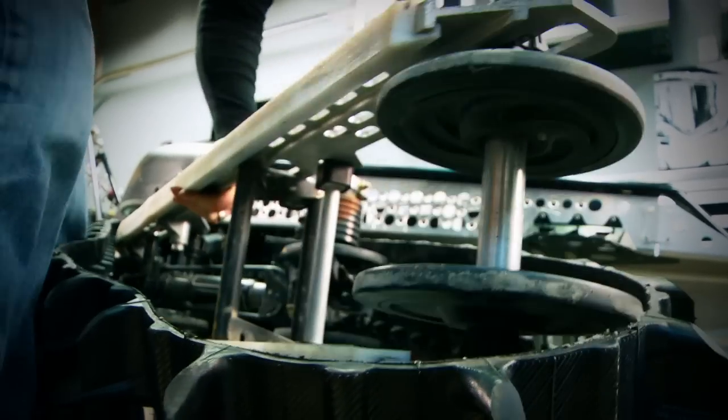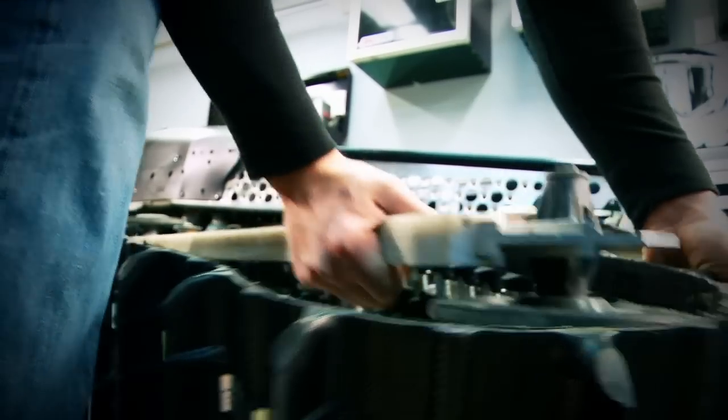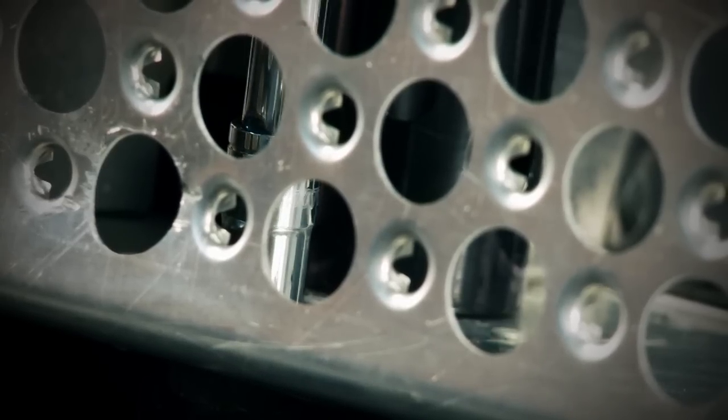With the front arm length of the 146 and 136 inch skids being very similar, I decided to use the same front bolt locations. This means the angle of attack will be very similar. With the front bolts in place, I can pull the skid frame up into the tunnel and roughly mark where the rear arm should mount.